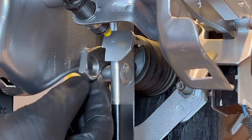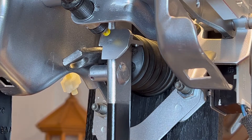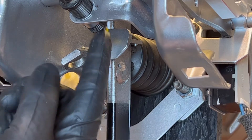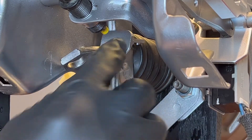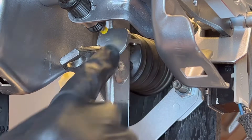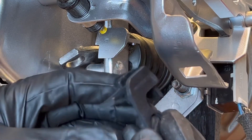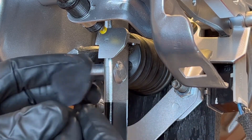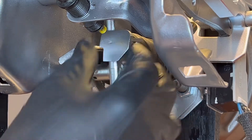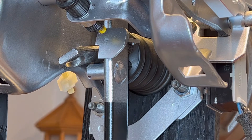The rod swivels around and you've got your brake pedal — it's now free swinging, not attached to anything. This switch up here is for your cruise control, we'll cover that in another video. There's also this piece here — it looks like it's part of the metal of the pedal but it's actually plastic, and it pops off like this, clipping onto the pedal. I'm going to leave it as-is since it was painted on the pedal, but I wanted to mention it.